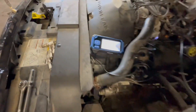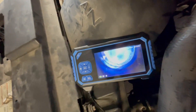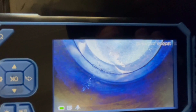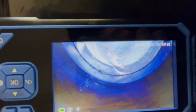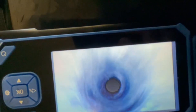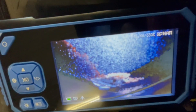We've gone and got the spark plugs out and our borescope is ready to roll. I've been down each cylinder so let me show you what I found. As we go down into cylinder number one, we can see a little bit of a mark at the top of the piston — looks like the valve has kissed that piston. We go over to the second cylinder and we definitely got a kiss on the piston right there. It's definitely hit the valve.